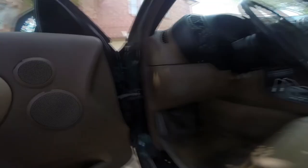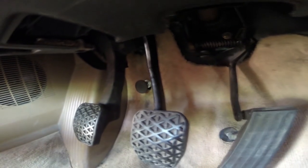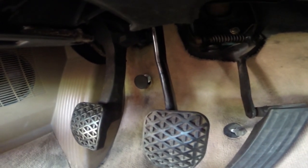The next thing I installed is a clutch stop. I got it for 10 bucks off eBay — the guy that makes these is a forum member somewhere. These things are great because when set correctly, the clutch bottoms out just past the point of engagement, minimizing how far you've got to push. This car without the clutch stop has a really, really long clutch throw, and about half of it is just wasted travel. Like I said, 10 bucks — totally worth it.